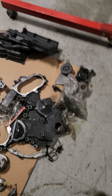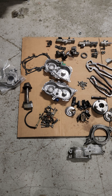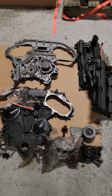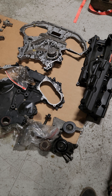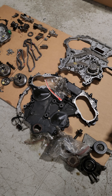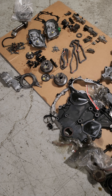It's rookie stuff — reusing bolts with no loctite, reusing old front and rear seals, a stock oil pump on what's supposed to be a twin-turbo build. A lot of these guys pulling these scams are just cleaning up parts. You really need to pick who's putting your engines together. Preferably the same machine shop is building your engine, or just run the same shop doing all the work. Make sure you've talked to other people and you're not just going off of what this guy says or an amazing price — this isn't supposed to be cheap.